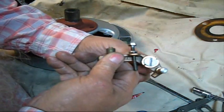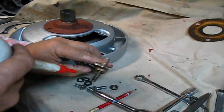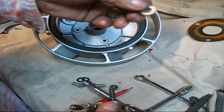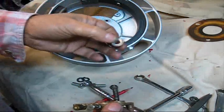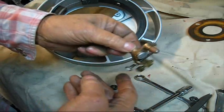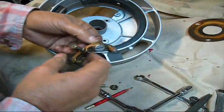You see how that turns so smooth? I did clean out that thing right there, and I am using this wrench right here — it fits right in that groove. Put a little oil right there on them threads — not much, just that's enough right there, just a little bit. Everything's oiled up really good. Y'all see that little stainless steel washer right there? That's really important. The shiniest side, the slickest side of it, goes outwards towards the governor arm itself. You do want play — if you hold that tight against that washer, that needs to have free movement with no restrictions whatsoever.